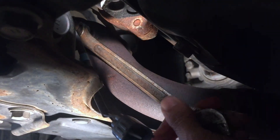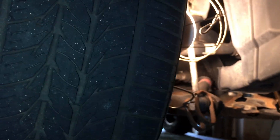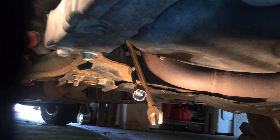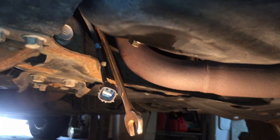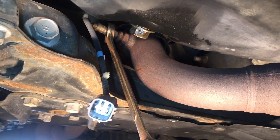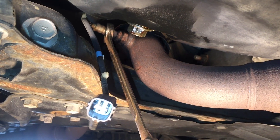It broke loose! I let it cool off for about 10 minutes — I didn't want to touch that sensor with it being so hot. There's the passenger side front tire with the wrench hanging down, so you can really see where that sensor is located. You come in past your oil drain pan and straight up through that channel is the O2 sensor, bank one sensor two.